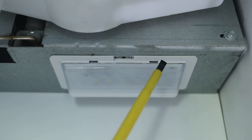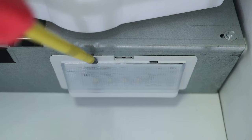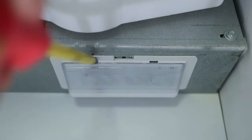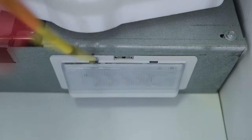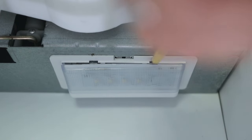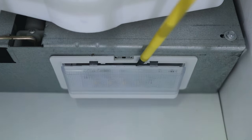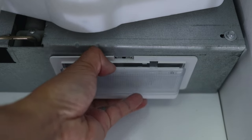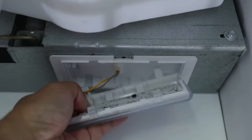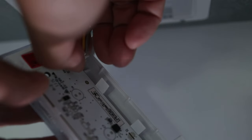Taking a closer look, you'll have to release tabs in these two slots. The best way to get this out is to insert a screwdriver pointing to the back of the fridge, then use some moderate pressure to pry it down. It might take a few tries but just remember to push the tab in a bit. When it's released, you can pull the entire assembly out. Next, disconnect the wire connector by pressing a small tab on the side and then lifting it up.